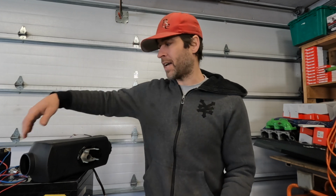Okay. So that is actually quite a substantial difference with or without the tape at the higher air speeds. Again, the reason is that the higher the air speeds, the more the resistance to flow through the exchanger, and so the more it is going to force air through the combustion chamber. If I completely blocked this hole off, the outlet for the hot air, it would force even more air through the combustion chamber, but that wouldn't do us any good because then no hot air would come out. So at the lower air speed, it was 10.12 kilometers an hour versus 9.02. So that's actually worse. But at medium, we were 18.5 and 19.8.